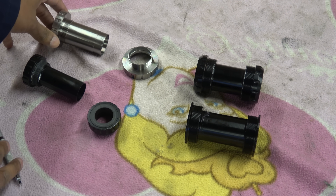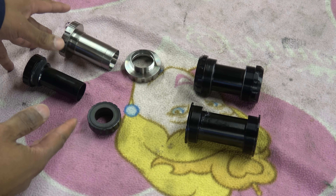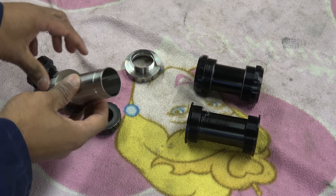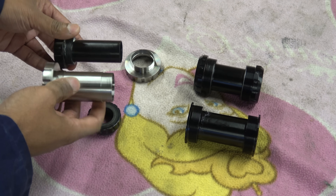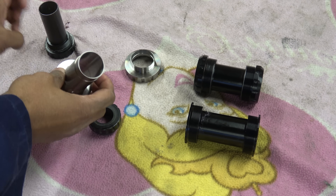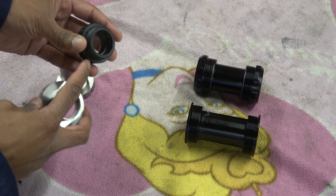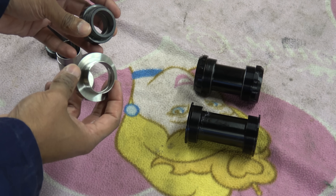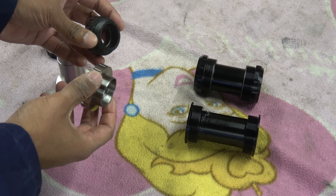Modern standards have moved us towards this type. This is a titanium bottom bracket, and it exists because people have started putting 30mm axles into BSA-type bike frames. The center sleeve is considerably bigger diameter — it's designed to take a 30mm axle — but the periphery width off the end is the same. The problematic reason with BSA and 30mm axles is you see here where the threads are: the wall thickness is quite thick on the 24mm but extremely thin on the 30mm. It's quite difficult to manufacture that accurately because the material tends to warp slightly.